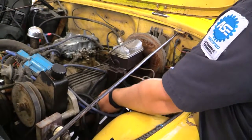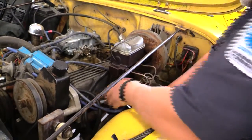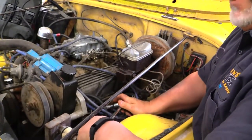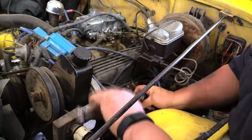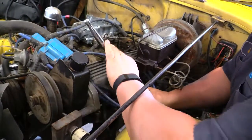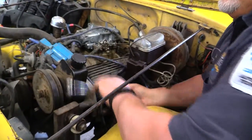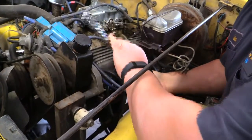These are usually elongated spark plugs, and you also want to think about using the right spark plug for the right engine, and make sure that it is indexed into the cylinder itself. A lot of times guys think hotter is better. It's not. You actually just want to have it indexed correctly so that the spark is going down into the cylinder. What I mean by indexed is that when you tighten this spark plug up, the majority of the spark plug edge is going to be pointing downward, so you get the most fuel efficient burn, and that's where the electrode needs to be.